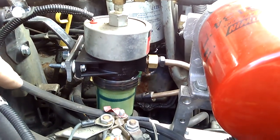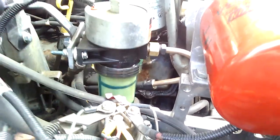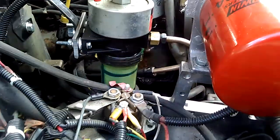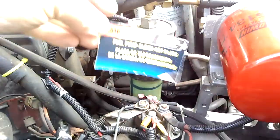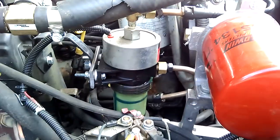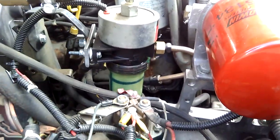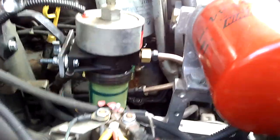If you install one of the electric pumps, you don't want to run both the mechanical factory pump and the electric pump at the same time. You're going to need a fuel block-off plate — I think it's called a Chevy big block block-off plate. The one I got from O'Reilly's: the Mr. Gasket fuel pump block-off plate, part number 1516. It's diamond-shaped and gives you a fresh gasket — mounts perfectly right over where your old mechanical pump was.